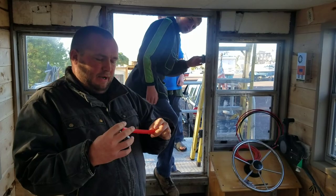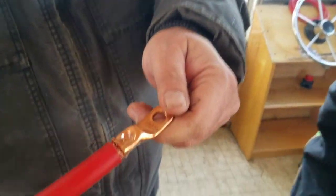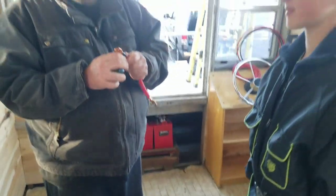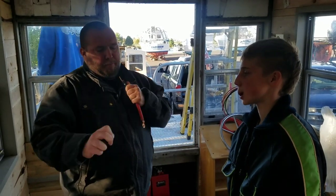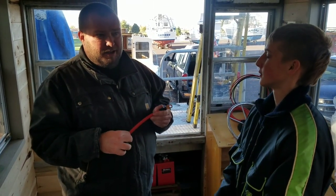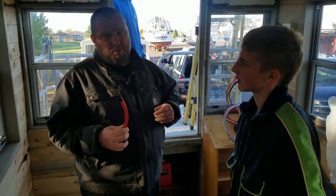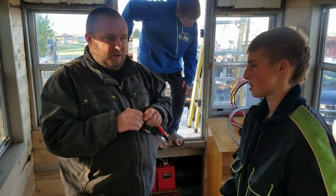What are these, Mike? Right here, we're making our own cables. We've got a punch crimper that you put these cables on — this is a 1-aught cable. It's quite honestly a little bit of overkill for this size of a system, but it's always better to be a little bigger. That's what ties the batteries together? Yeah, it'll tie the batteries together and also be the main cable source to the power inverter, which is only 1,500 watts. So we're talking 100 amp draw at the most, and these are rated anywhere from 200 to 400 amps, so you never have to worry about them getting hot. A little bit of overkill, but it's a very robust setup.